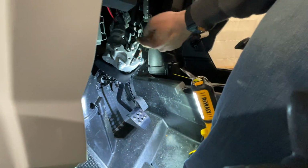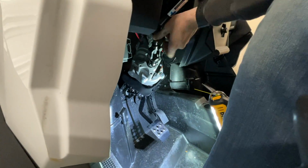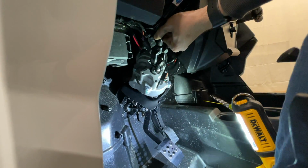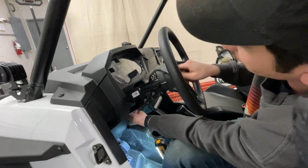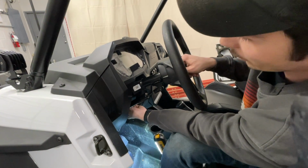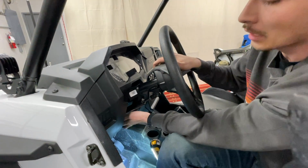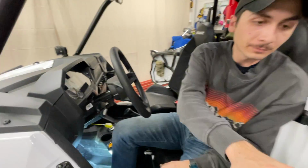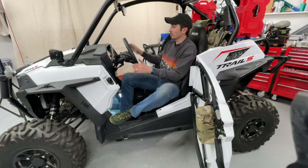Notice how right here, this is how it's naturally sitting because we haven't tightened this. Now I can get my steering wheel on, but notice it's not hooked up to anything, so I can just twist it. So I come down here and push along this rod right here so it gives me some slack. And when I do that, I can fully seat my steering wheel. While I'm still pushing out all the way, I'm going to start this thread right here in my steering wheel. Now I've still got a little bit of play, so I'm going to thread this steering wheel so it's nice and tight, and it'll pull out as far as it needs. Then where it winds up sitting, we can tighten it up so that there's no play forward and back. But before you get going on the impact wrench, take a look, Nathan, in the front and tell me if you think that's where your wheels are straight.